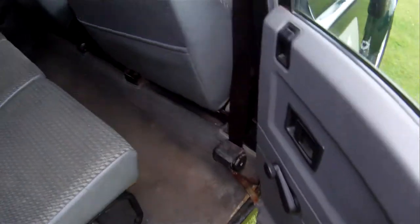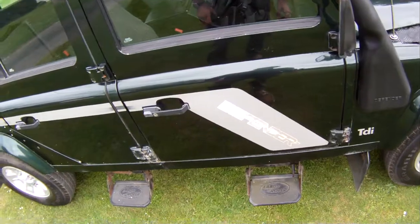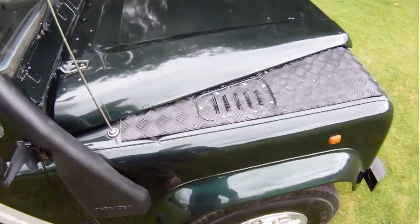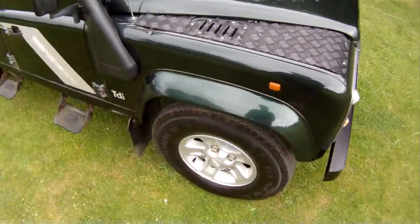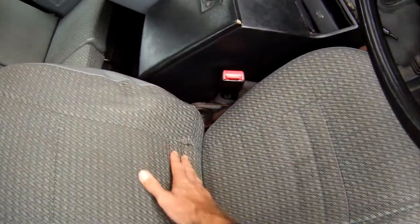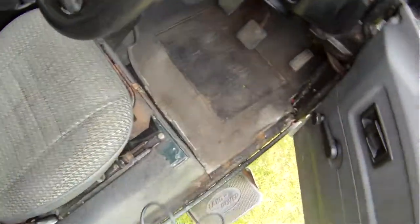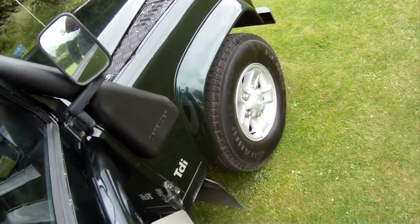The off side rear door has rusted up in the usual spot and down the bottom of the frame, but it's quite solid on its mountings. The off side front wing has got a dent just up here which goes underneath the checker plate — something we didn't mention: it's got checker plate on the wing tops. The scuttle corner on the off side is spot on — very nice. Inside on the driver's side, the driver's seat backrest is a bit worn with a tiny split in the backrest. The driver's door frame at the bottom is poor along the bottom edge, and again there's a bit of movement at the bottom hinge pin, but not in the door itself.